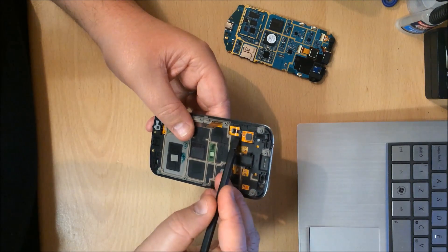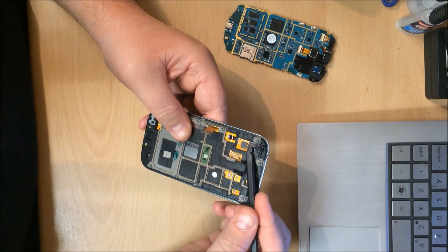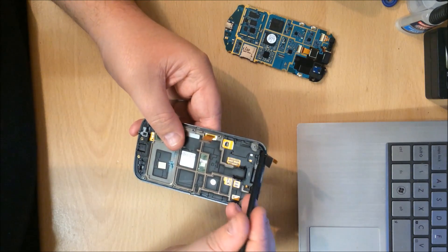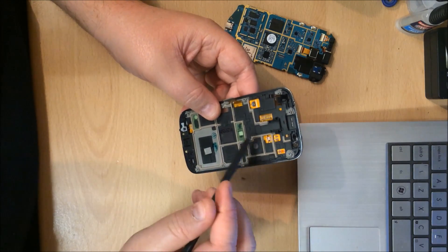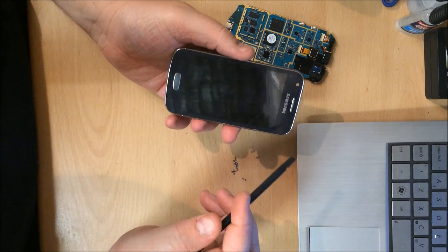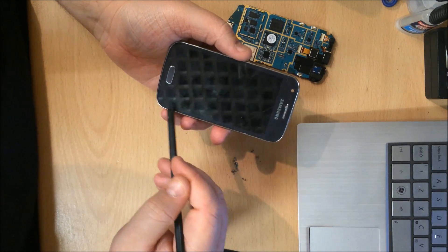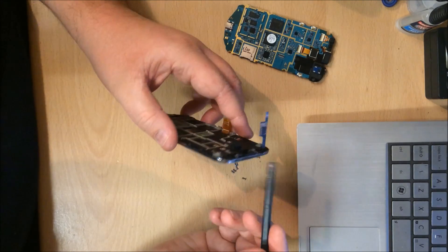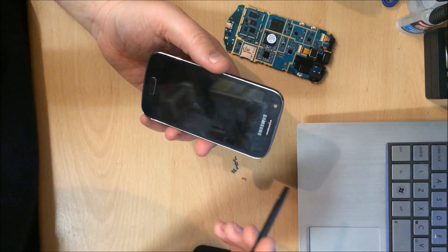Lifting this one up — it's normally held down with a tiny little bit of glue. Gently pry it out and lift it up. What we'll have to do, just like in the other generations of Aces, is you won't be taking the LCD out. You'll be getting a warm running plectrum around the edges to loosen it up, then peeling off the whole screen, feeding through that flex, and putting the new one on in the same way.